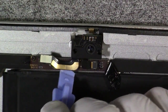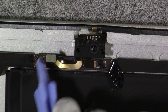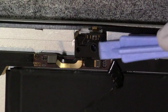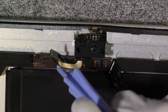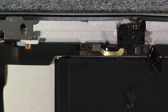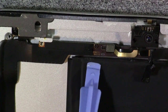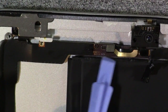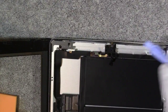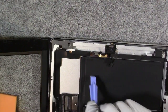This is what was messing with it — disconnecting this right here. I made a discovery where it looks like something might have overheated and caused this connection to burn out, because it looks burned. I'm not too sure how you would go about replacing that. I don't think it's the camera module itself but the board it's on, because that does look very burned. It could be a defect, but I highly doubt it.